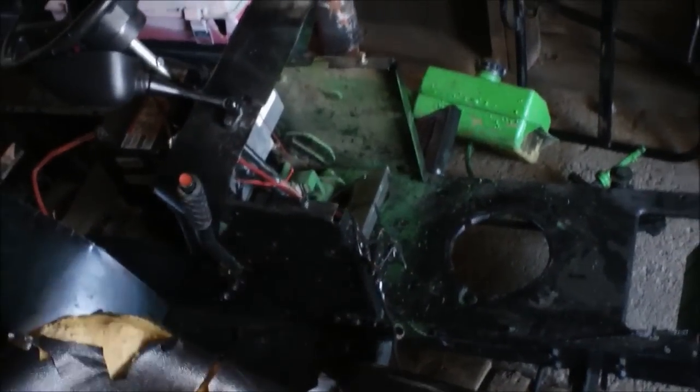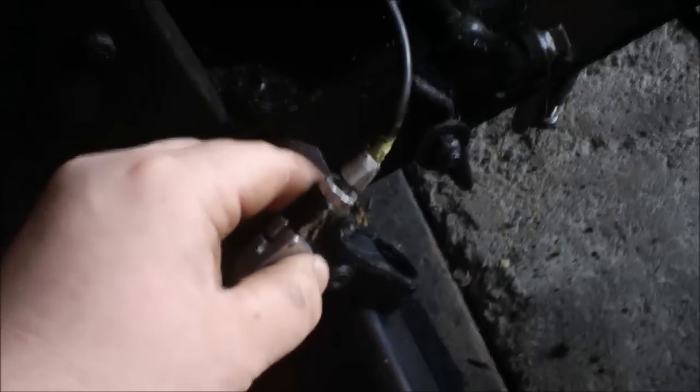I think I'm just gonna keep it simple instead of welding or anything like that. I don't want to lose these — I like these — I already glued this one, the other one has to get glued back on. I'm just gonna bolt it straight to the frame and it'll reach. So I'm gonna drill right through my little skirt, probably right here, and just put a bolt through with a couple washers. Give me one second.